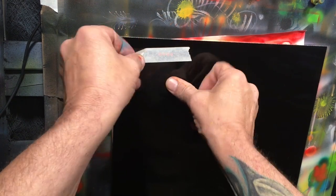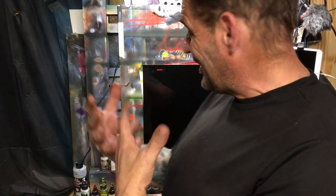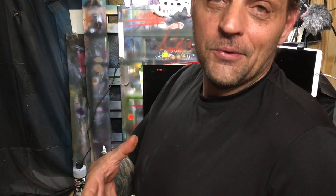Let's try that tape pull again. As you can see, those dots remain. That's testing the adhesion between the panel and the paint — and that is excellent, very good adhesion, and I didn't even prep the panel properly. You should sand this panel down and clean it before painting. I'm making a worst-case scenario, and you should be using an automotive tape that's less sticky. If you paint on a panel you haven't prepped and the paint comes off, don't call and tell me about it.